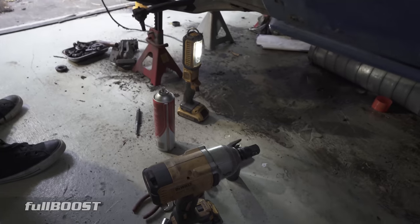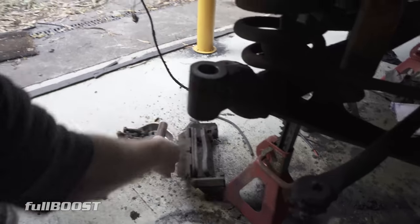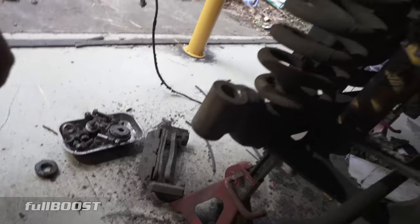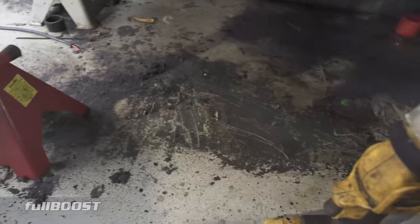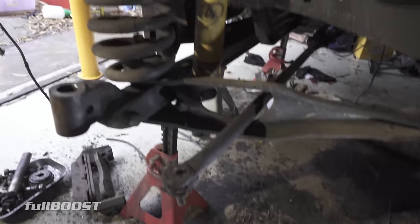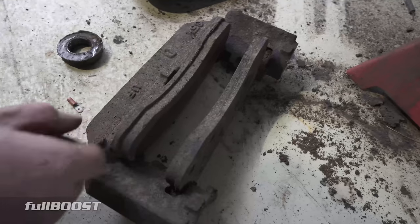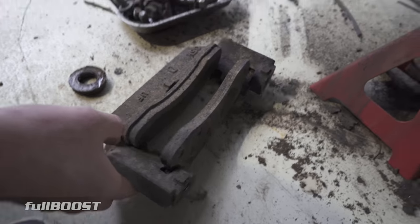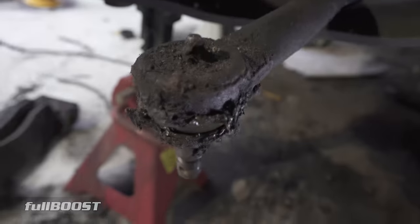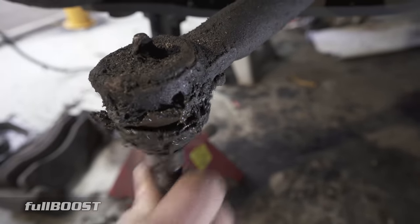So this is our front setup — double I-beam. This is a sort of steering arm and the hub goes right here. The king pin is quite rusted and slides all the way through here. These are the old bearings — you can see the amount of dirt and junk that has compiled because the grease naturally comes out and covers everything. These pads have seen better days; there's a lot of meat on but there's rust on the back, and normally it's bonded by a bonding agent so that could collapse.